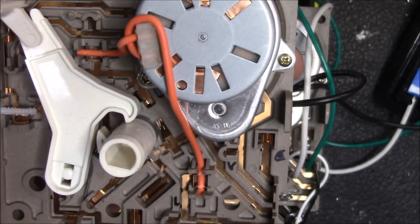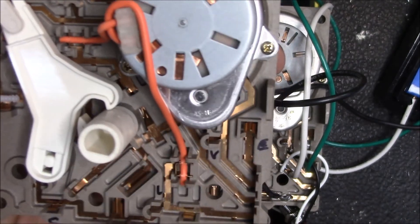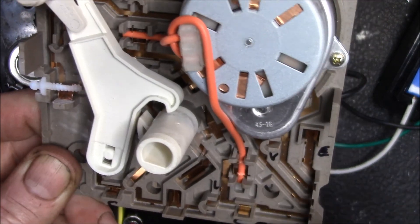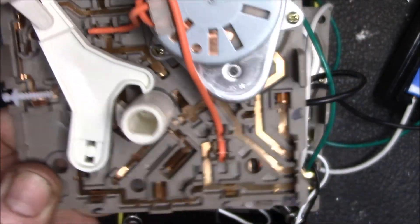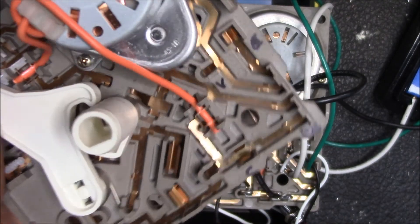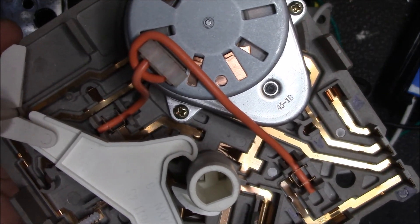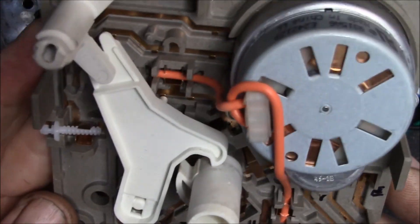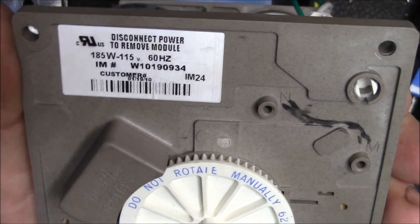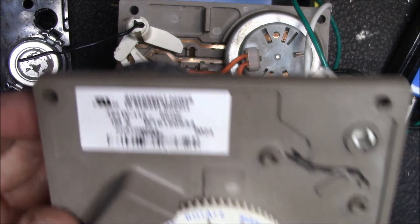It's a really brilliant, cost-reduced and quite reliable design. This thing is inside your freezer, and every time you open the freezer door warm humid air comes in and condenses on metal surfaces — it'll freeze into frost. Any normal contacts would get iced up. If this were a flat circuit board, ice buildup could bridge between two traces. But you can see how they've recessed everything for safety. There's great separation because the whole board is live at mains voltage, yet on the side you see there's nothing conductive — it's all plastic insulated.